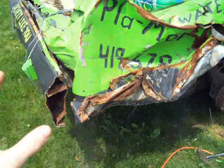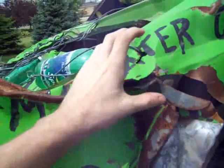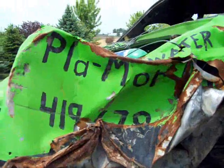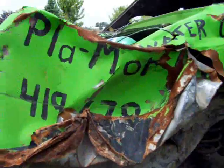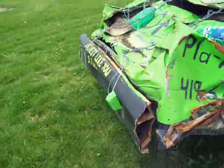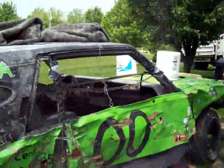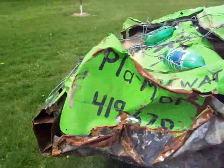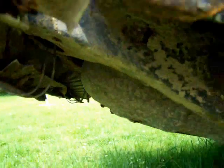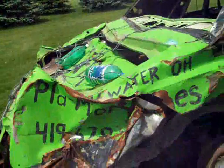As the rest of this frame collapses, the idea is to get your bumper to go up, then fold again and end up back here — this entire area will be balled into a big strong ramming mess of metal, and yet you'll still be able to see out of your back window. If your trunk bends up too high, your bumper is going to block your view and you can't go backwards anymore; then you're stuck using your front until it's wasted. So the best idea is to notch your frame — not too far back, but enough to get it rolling in without blowing out your humps. It all just packs in really tight; so far it's doing good.